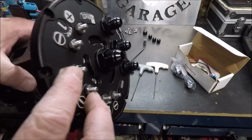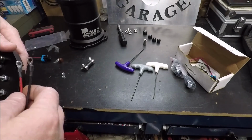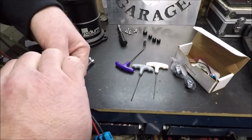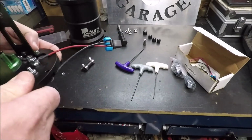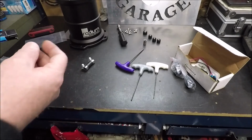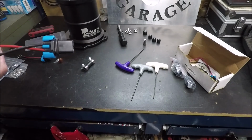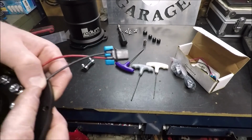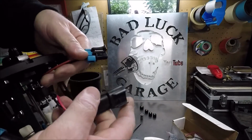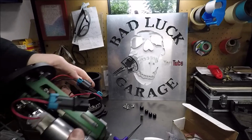Just my opinion. Onto the harness for pump 2, which is these 2 prongs here. So we'll go under here. We got positive. That's positive. Got our little nut, goes on there. These are actually lock nuts. Interesting. So they're making sure they don't come back off on you. That's awesome. So they're directional. You have to put the little indentions facing up. That's why I was having trouble getting it started, because that's the part that locks it down. So it'll only go so far, then you have to cinch it down, which I'm guessing is 10 millimeter. So we'll just plug, that's pump 1, yep. Plug pump 1 into pump 1, and pump 2 into pump 2.